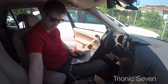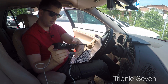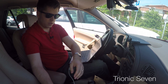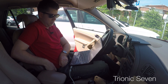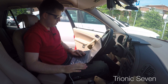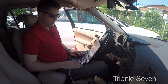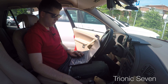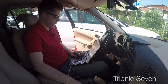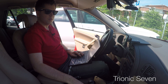Okay, everything is inserted. I can see the LEDs here lighting up on the Combi adapter — it's a bit hard to show on camera though. I also need the key, of course. Just inserting it, not turning it. Okay, I think we can start. So Trionic flasher — I'm turning the ignition to on. I'm waiting a few seconds. I can hear the fan starting. Now we turn it off.